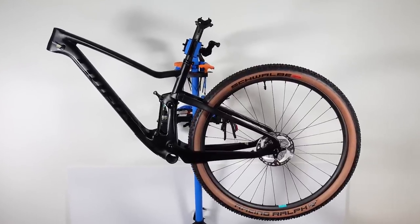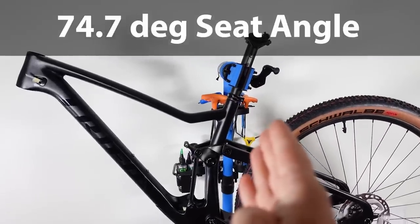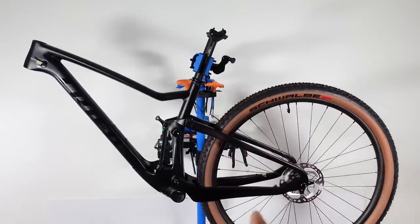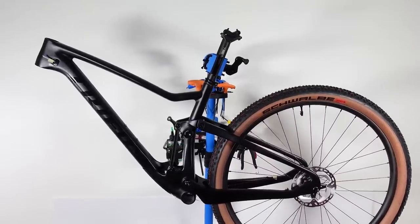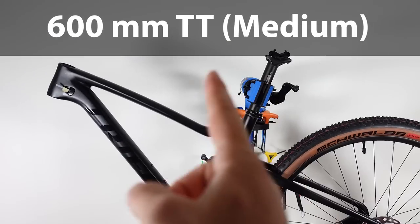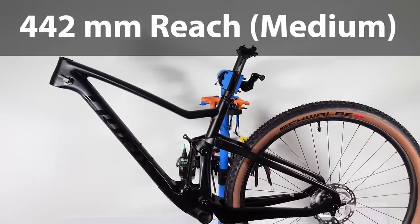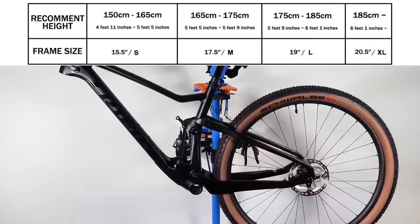I kept calling it a cross-country or down-country bike, but what about geometry? The seat tube is at 74.7°, so not too slack but not too steep either. The head tube is at 68.5°, which is kind of modern for cross-country — not the latest but not bad. Chainstays are 438mm across all four sizes, standard for a pedaling-oriented bike. The top tube is 600mm — my Yetis are around 604-605mm — and the reach is 442mm, the same as my new Yeti ARC. Geometry is fairly modern; definitely check sizing before deciding which one you need.